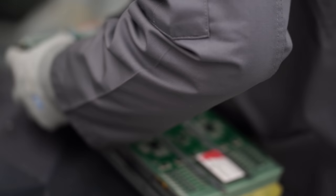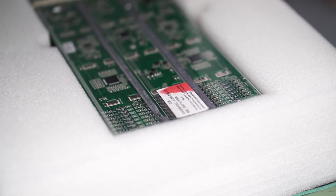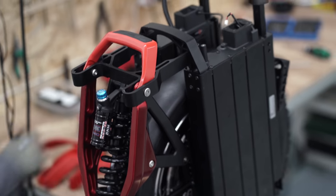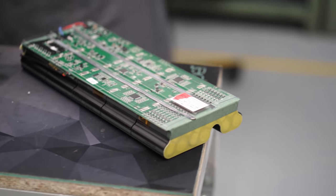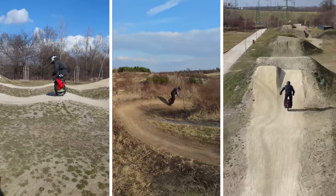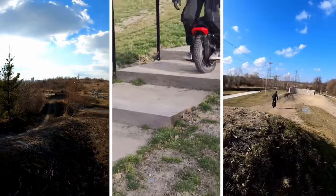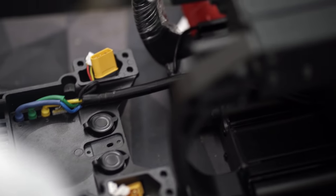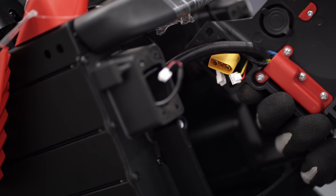The Kingsong S20 has two large 126-volt batteries placed in aluminum boxes with rubber seals on the lids. An interesting sticker appeared on the battery itself — it changes color after moisture gets on it. We consider this the right step since the batteries are protected as much as possible from moisture, and any moisture ingress would only be possible if the wheel falls into water or liquid is spilled on the batteries during disassembly, which naturally is not a warranty case. The manufacturer claims an IP54 rating, meaning dust ingress can occur but does not affect operation, and there is water splash protection. Kingsong engineers took this issue very seriously, and we managed to find only one weak spot — just under the cover where the motor cable comes out, there was no sealing gum, and theoretically water can get through this hole if, for example, you put the wheel on its side after rain. We reported this issue, and Kingsong assured us that additional protection will be installed. If this does not happen, we would advise trying to isolate this hole for maximum safety.